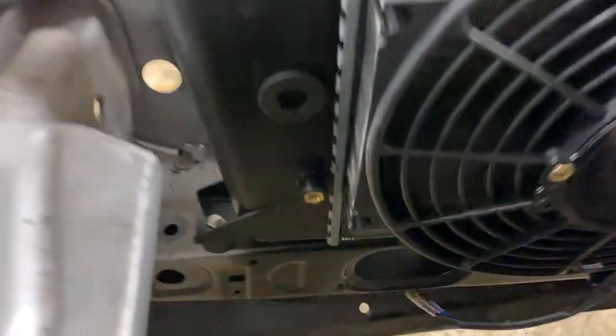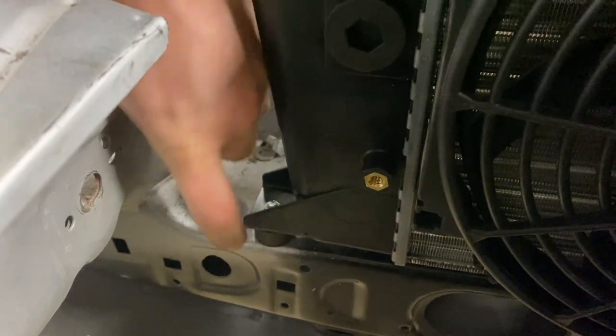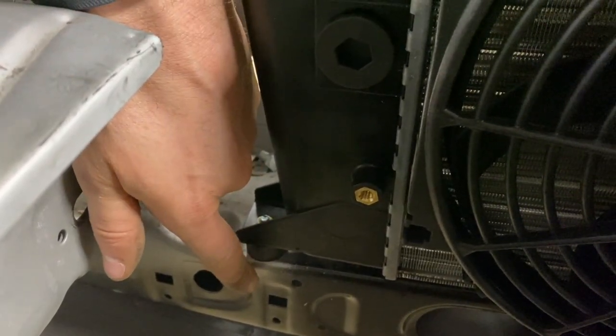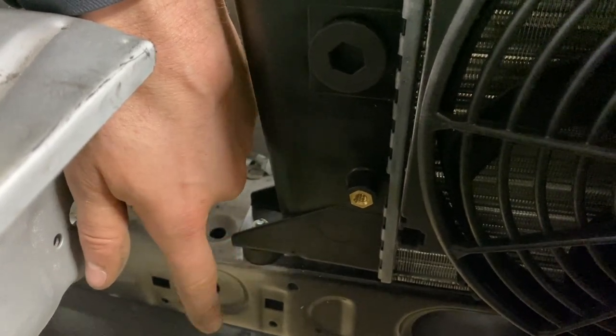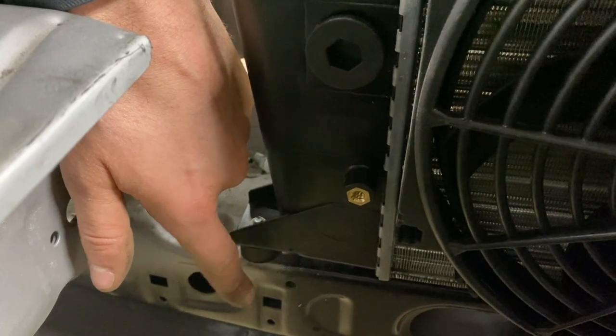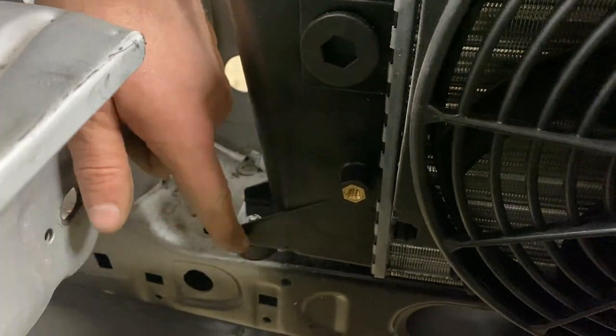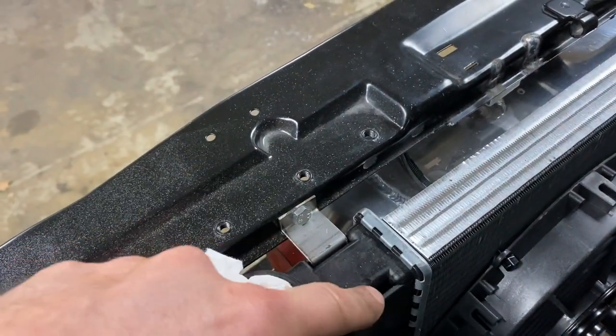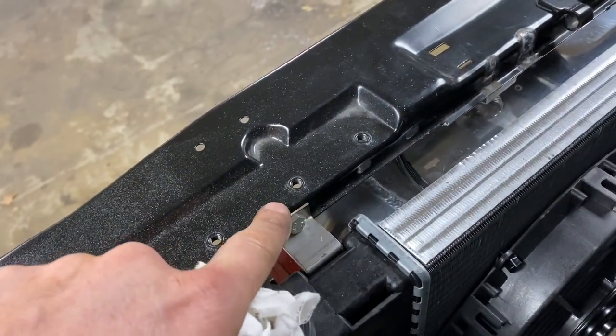So what I did was, there's some rubber mounts that came with the radiator. All I've done for now is drilled a 6mm hole in this front panel, both sides. What I'm going to do is put a nutsert in there, a threaded sort of rivet, that we can wind that onto, and then we can do that fixing up to hold the bottom. And then the top, this side, you've just got an L bracket that goes down into a slot, and that bolts onto the front panel.